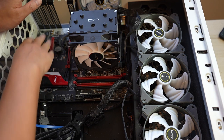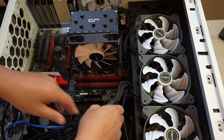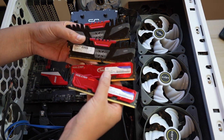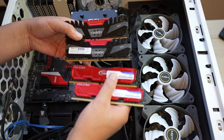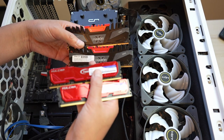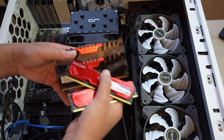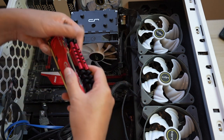Getting everything out — the hardest part was actually the power supply, I had to press really hard, but everything else was disconnected fine. My RAM is thankfully DDR4, though unfortunately the sticks aren't the same speed — one is 3200 MHz and the other is 3000 MHz. Eventually I'll replace all of these, but at least I don't have to buy new RAM for the new board.